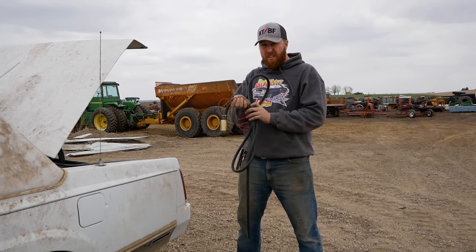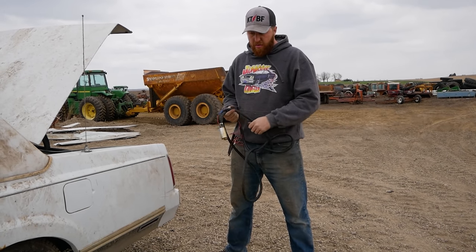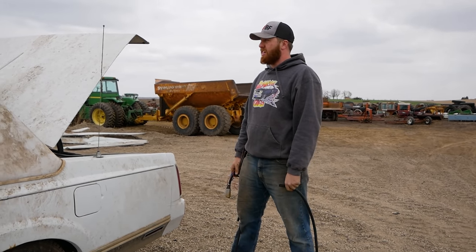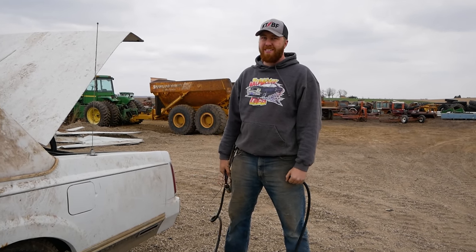All right, I've got a fuel pump on a chunk of hose. We're gonna drop this down in the tank through the fill neck, pump all the old poop ass out, and change our sending unit and put some new poop ass in. Assuming a nearby O'Reilly's has a sending unit. If not, I brought a pump from a lawnmower. It'll be okay. We'll be fine.